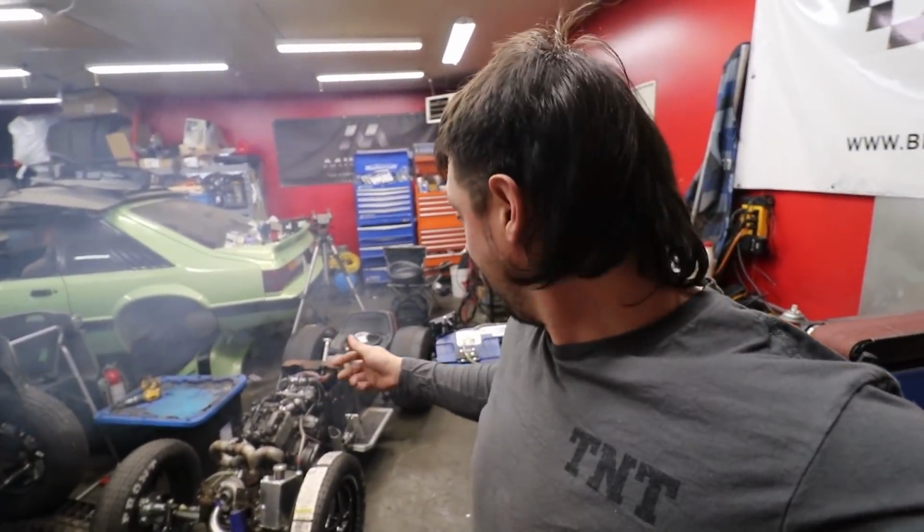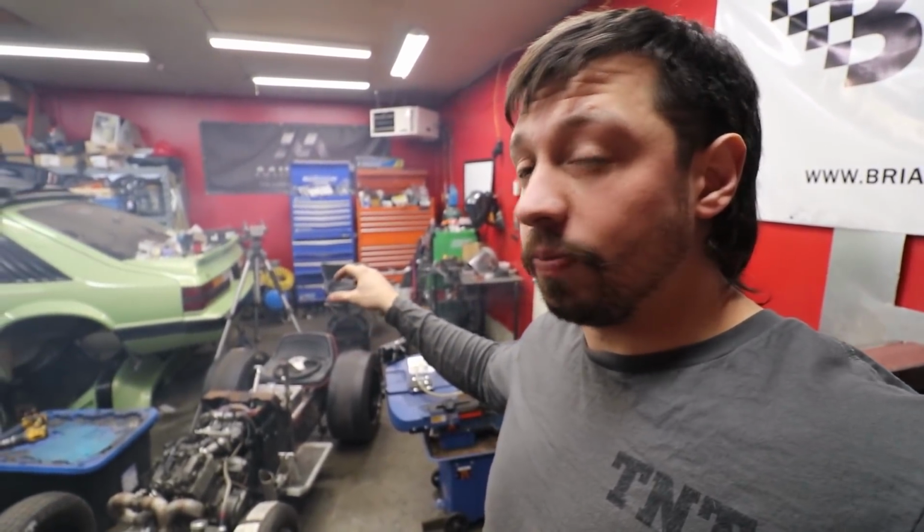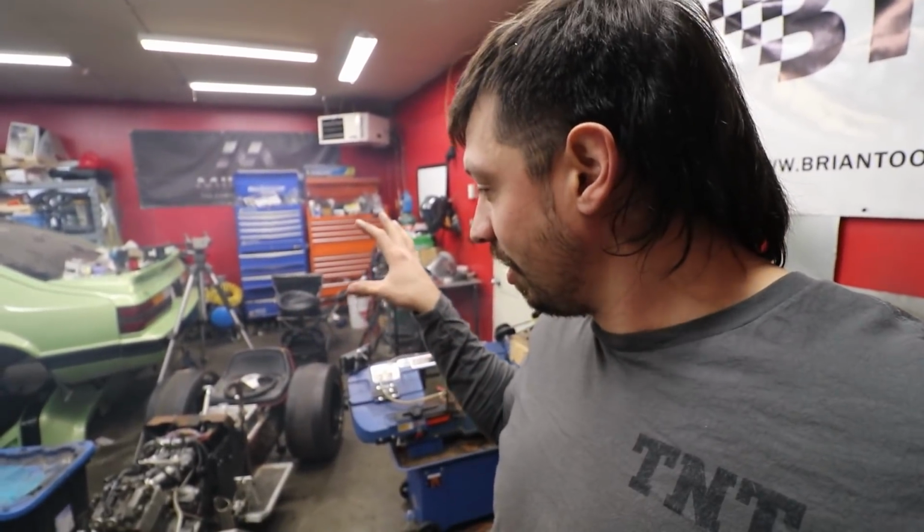I don't want to smoke it out because I didn't get my laptop and pull any fuel out of it yet, but it just fired right away with the key. So I have to set up our rear end right now. I have to pull the wheels off it, center the axle again, put our keyways in the brake and the chain sprocket, hook the chain back up, and then I'm gonna get the rear end in the air, and when we start it next time, we should be able to test our clutch, our brake, our fuel.